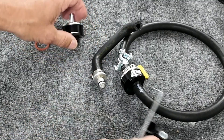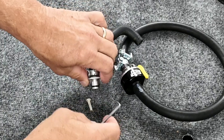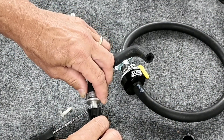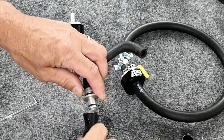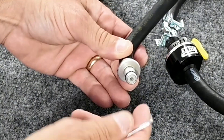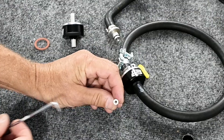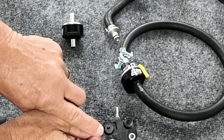This inline filter is your first weak link. Back in 2012 when this bike first came out, they had these stupid little filters because they fit up into the fuel rail on the EXC four-stroke bikes, but nobody could get to them to change them and they would clog up all the time. So they switched over to this quick disconnect setup, but I think they just had a million of these small filters left and continued using them here. When you're out on the trail and your bike starts to run like crap, you've got to get this thing apart somehow and pick it out. They even give you seven or ten of these things in your toolkit — because they know it's a huge problem. And look at this: the incoming hole is extremely small, smaller than even one of the fuel rail holes. Just look at this pit.